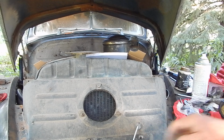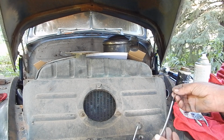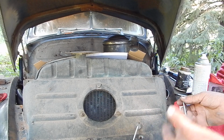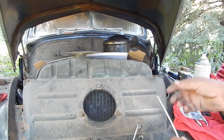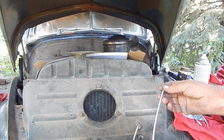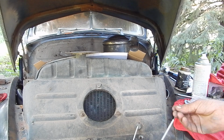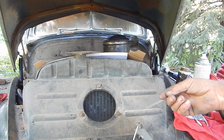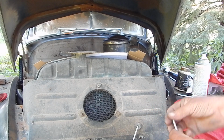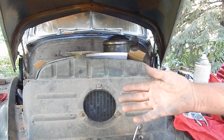But when I put this cable in, this cable was extra long. I had to cut that much off of it. I think it's because, like I say, it was used in Buicks and Oldsmobiles and whatnot. They might have a different configuration or a different location where the button goes. But I just pulled the cable back and cut it off to where I needed it. When I put this thing back together, before I did it, I coated this inner with Never Seez, which is why I got silver hands.